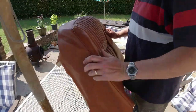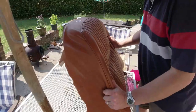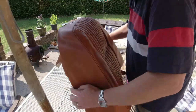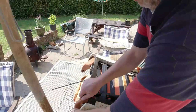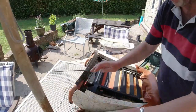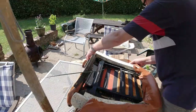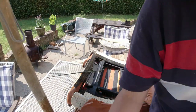Taking your time here is the most important thing you could possibly do. If you tug this thing in the wrong place or pull too hard, it's just going to tear the outer seat cover. Some folk absolutely swear by wrapping cling film around the foams and then pulling the cover over that. I've pretty much always done them like this — I found that these foams from Southeast Trimmings are good enough that I can actually just pull the cover down over the top of the foam. This is being filmed in real time, and I think I actually get this cover on in about three minutes.